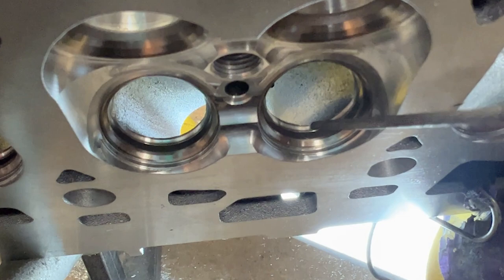All right, so I took out the little nub on the intake port and I picked up 2 to 10 CFM from 200 lift to 400 lift, but I lost 2 to 3 CFM from 1 to 200 lift. Is that a problem? No, it's not a problem and actually could help a little bit with reversion.